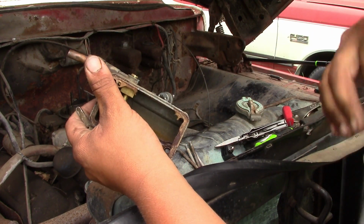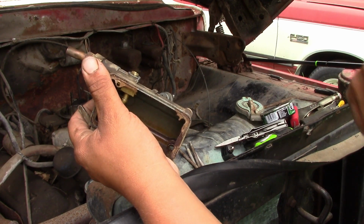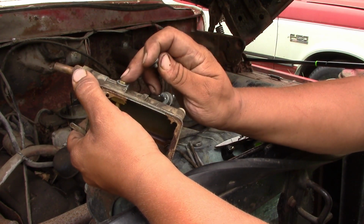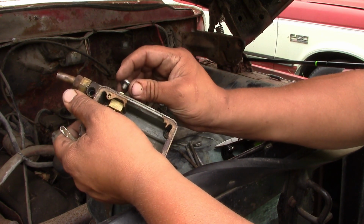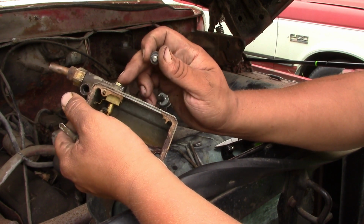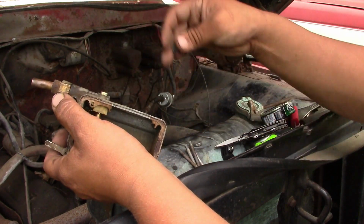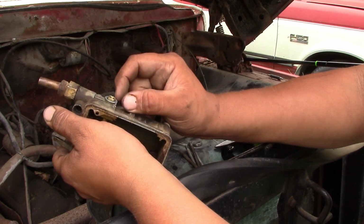Okay, let's see if that is enough to get our nut on top. Now I cannot get this screw into the needle and seat. Must have been when I tried grabbing it with the pliers up here, I must have squeezed it together because it is only brass. So I guess we'll finish turning that out. We'll have to get a tap, run that down there, tap it out.